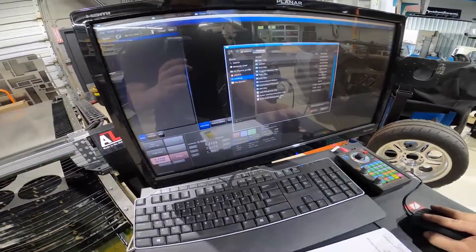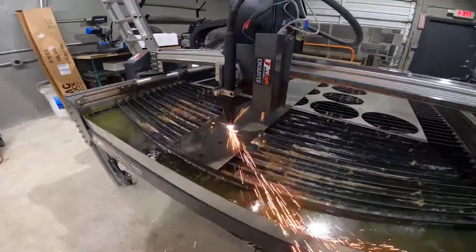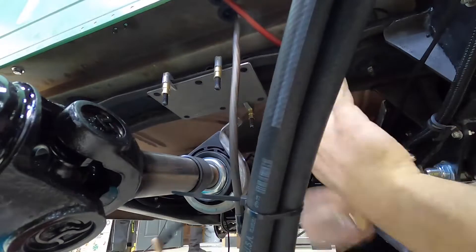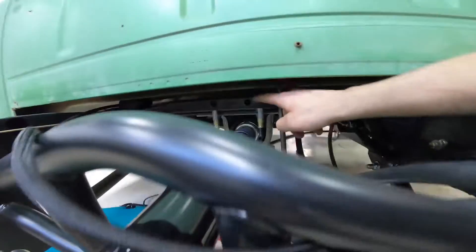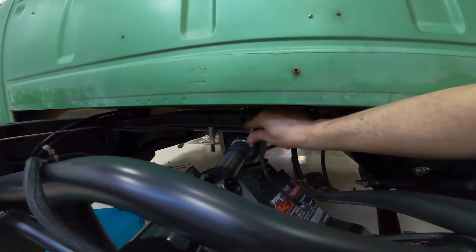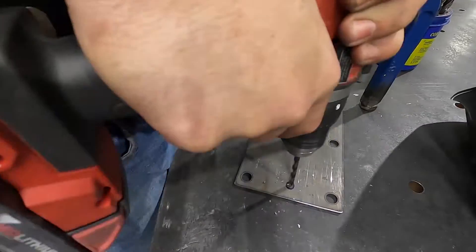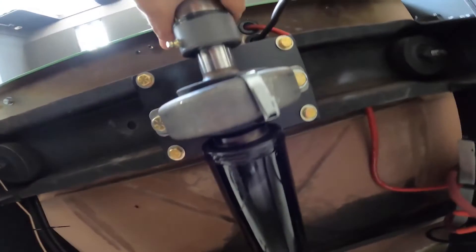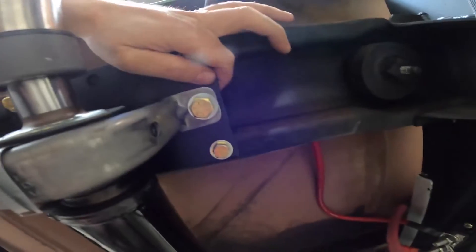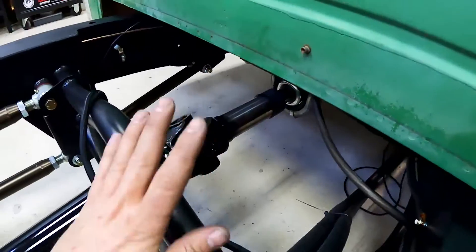It's going to be a pretty substantially thick plate — probably going to do six bolts because we like to be overkill with stuff like this. Our bearing is in place, held up by the floor jack. We're using Leco clamps to hold the plate up. We'll have six bolts holding the plate to the frame and two bolts for the actual bearing — so we'll mark the holes, drill them up, drill six holes in the frame, and bolt the whole assembly in. The driveshaft is in, bearing plate all bolted up with grade-eight bolts through the quarter-inch plate to the cab. Now we can focus on the cooling system at the front of the truck and get our overflow tank hooked up.